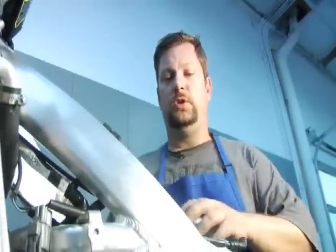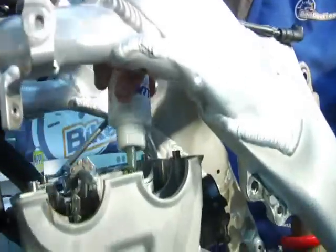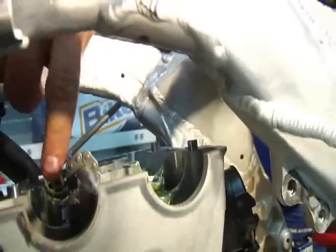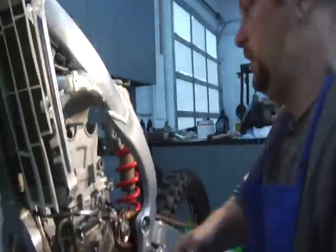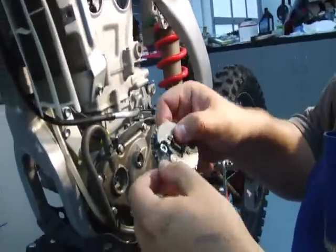All right, bolts are torqued. Lube is your friend, always. So we've got some moly lube in here. Put it all in the channels where the cams are going to sit, and then it'll help on break-in. It's Lucas Oil lubrication. Cam chain is being held in close. Tension is off. I always start with the exhaust cam. I think you probably should too.